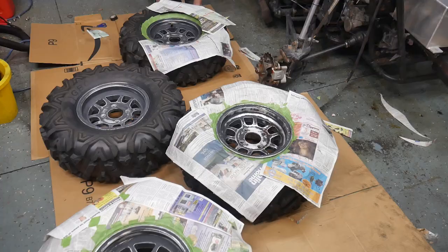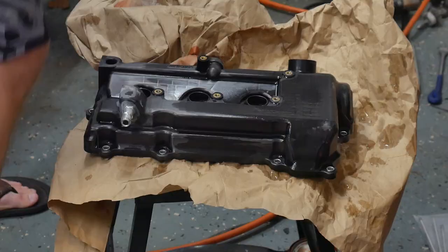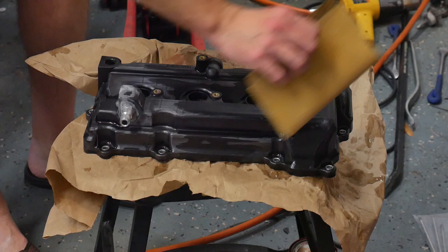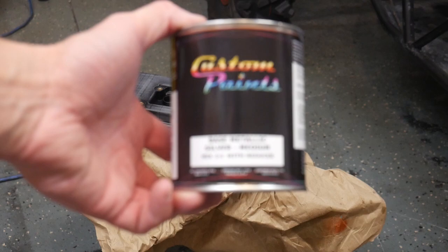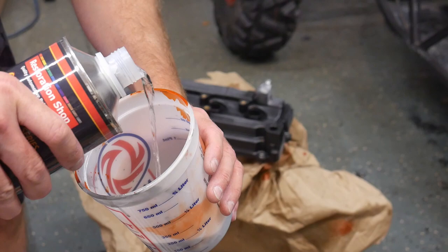What I have here is some footage of me spraying the valve cover. I took the same approach with the valve cover as I did with the wheels — I sanded it down and cleaned it off with some Super Clean to degrease it. This would normally be the time to lay down a couple coats of primer, but I'm skipping the primer and going right to a base metallic silver from Custom Paints, using a 2-to-1 reduction with the medium reducer.